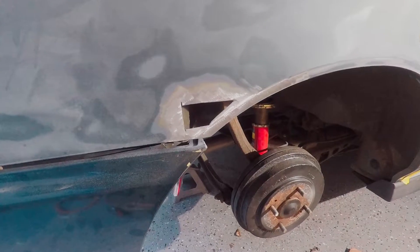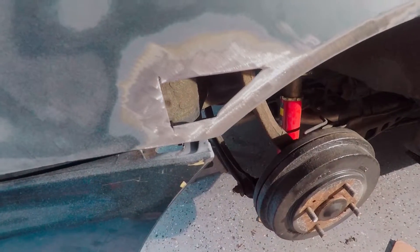It's now two days later. Looking up under here you can see I just threw a fresh coat of primer on there. What we're going to do now is grind that section out right over here and get ready to panel bond that piece in. I'd like to get that piece panel bonded tonight - I think that would be a good goal.